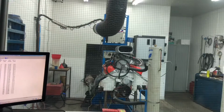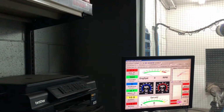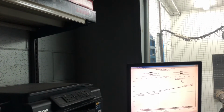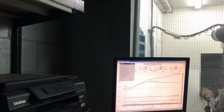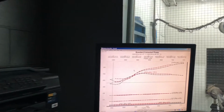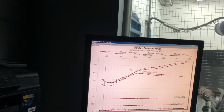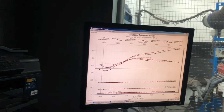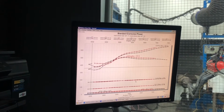Can you put the last graph beside this graph? I'm curious, just from heat. We made no other changes other than RPM and more gas. Maybe the octane booster made some difference. Maybe we're running out of octane booster now. Yeah, I wonder if we're not running out of octane booster. Or, but cold engine, hot engine too. What was our temperature difference between the two pulls? Nothing. The water temperature, but the oil temperature could be.